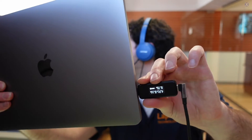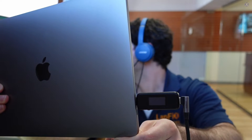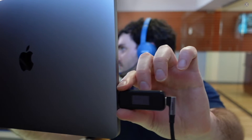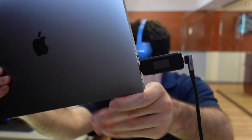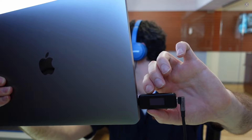Let's plug it in and see what we get. You see that? It reset — it was on and then it just turned off. Sometimes it will do a reset on the port. Let's try the other port — same thing. It kind of just turns off, goes on, turns off, goes on. That's probably saying it's not taking a charge, it's not powering on. Maybe something's resetting — probably there's a short. It's like, no more voltage, let's get out of here.